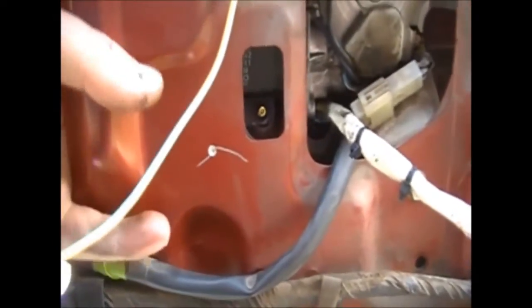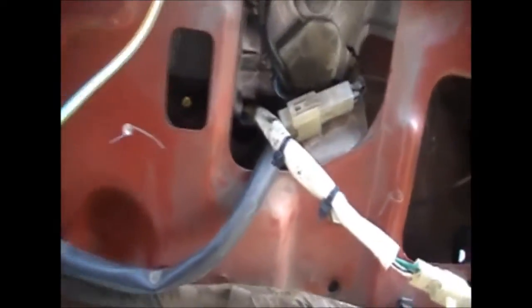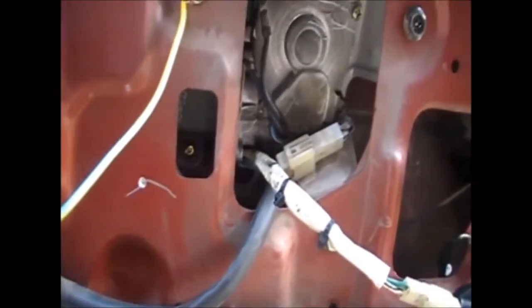To put this side light in, I have to drill a hole through here, big enough, say a 12mm hole I'm going to have to make there, because the bolt I need to get to is on the other side, and it's a bit of a trick to try and get a nut onto the thread. But it's easier if I drill a hole there. There's nothing in the way that's going to be a problem for me to drill a hole there. It's not going to weaken anything. So yeah, slowly moving forward. I'll keep going. Okay, see if we can get the sun out of the way here.